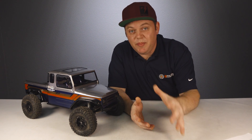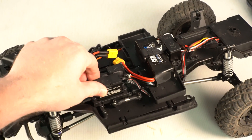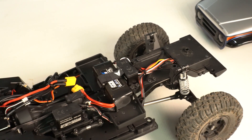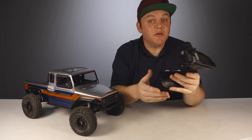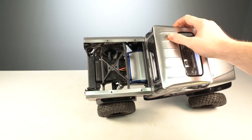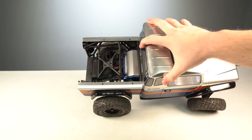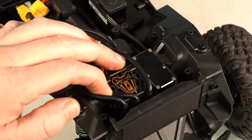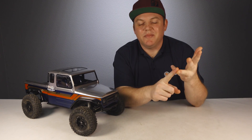The stock Fenix body comes clear and needs to be painted by the builder, and all remaining electrical components must be added. For our build we used a Protec 370 TBL for steering, with two EcoPower WP120T servos for the on-the-fly dig and overdrive — all waterproof, with aluminum servo horns running at HV voltage. We used the Sanwa MT44 as our 4-channel transmitter. The motor and ESC is the Castle Creations Copperhead 10 with a Slate 2280kV sensored brushless motor — a 4S-compatible system.